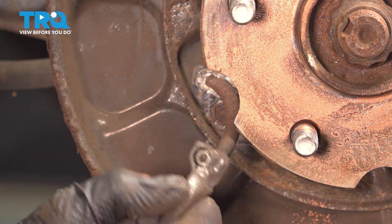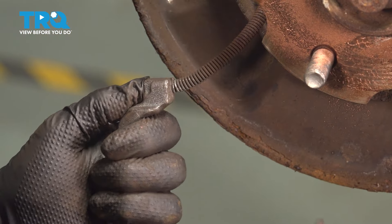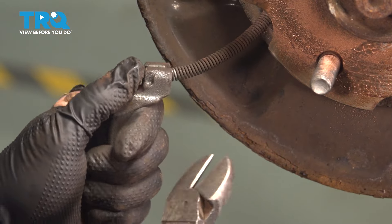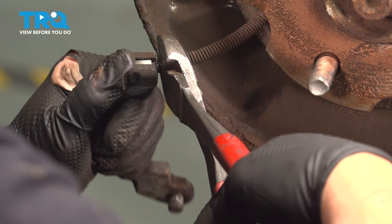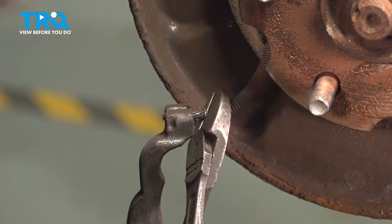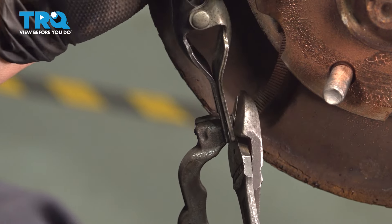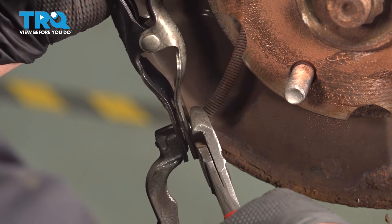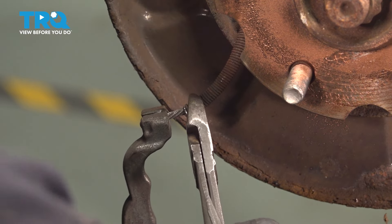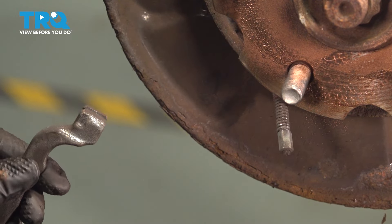Now I'm going to take this bracket off the parking brake cable. The best way is if you have two pairs of cutters — you're not going to squeeze hard enough to cut anything, just give it a space. I'm going to use a fuel line tool that's shaped like a V. Get that in there, slide it out just like that, and release it.